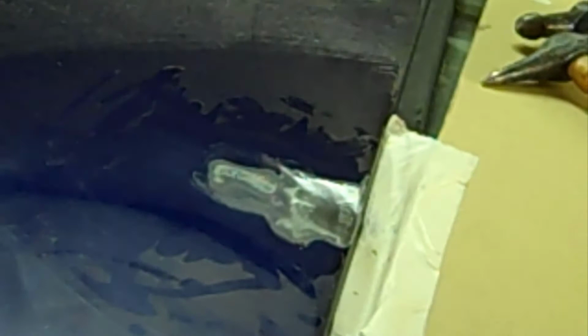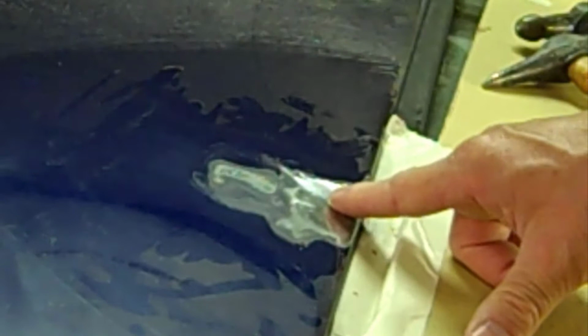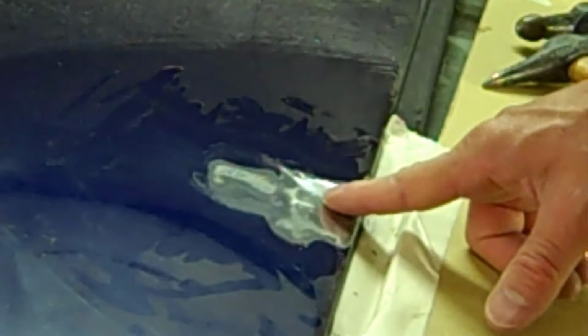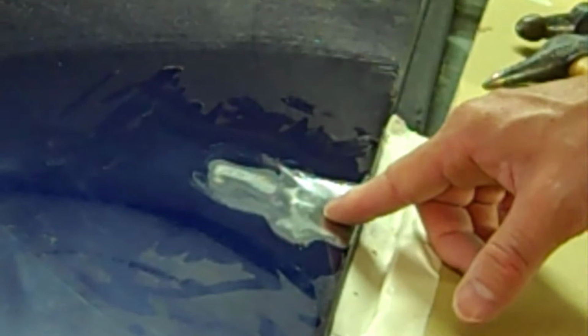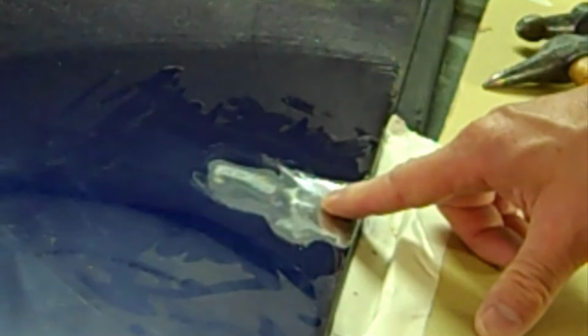And I could probably use more studs and pull this out a bit more, but this is actually an economy job I'm doing for someone. And two, the chance of you having a stud puller and stud welder and all these other tools I'm using is not likely, but there's just one method. Like I said, you could get that dent puller that uses the hot glue, or you can take the back side of the door off and start pushing from the other side. There is the traditional where you drill into the metal and screw your puller into it. I don't like those because it leaves holes in the door, which means places for rust to get into, no matter how much you cover it up with body filler or whatever. But that's some methods.